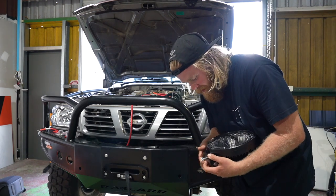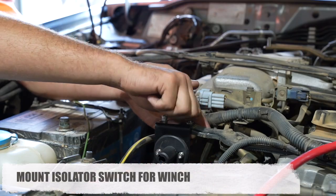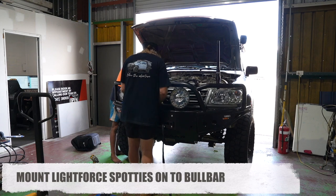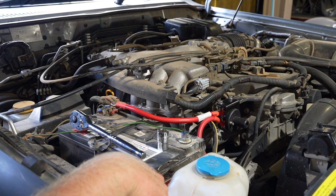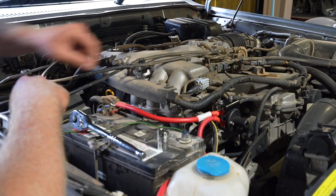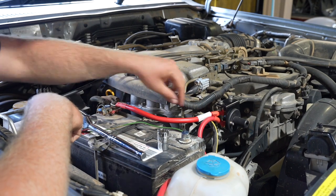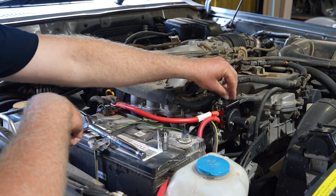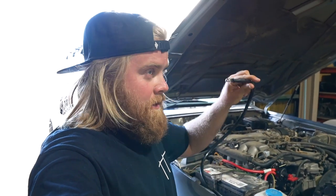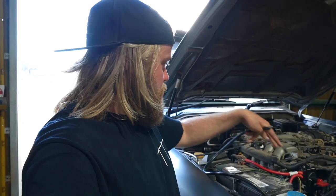I'm going to mount up the spotties on the bull bar here — they're pretty simple, just bolt on top and there are holes there for them to go in. This red one here is the power for your winch. You've got this one which comes straight from your winch to your isolator and kill switch where you can switch it on and off, and then another one comes out over to your battery to provide power. We just got to finish tightening them up — we drilled that bracket in and mounted it there. We're nearly all done now. We realized we forgot to do the negative for the winch, so we just had to undo that winch a little bit to get the negative on.